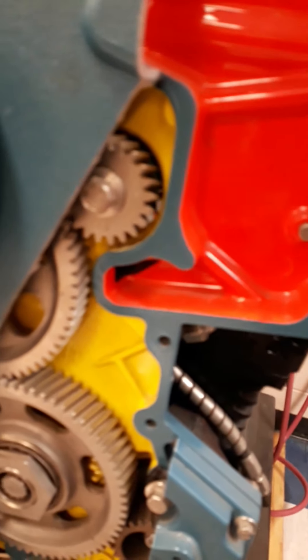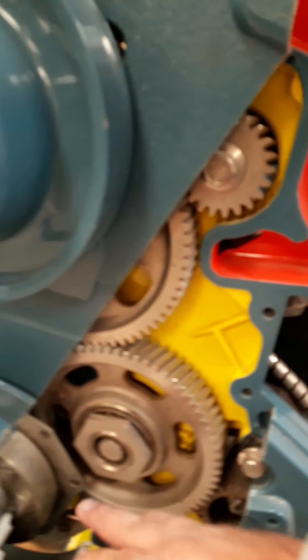Where this engine becomes a lot different is it uses engine oil to do the fuel injection. We've got our normal oil pump at the bottom that lubricates the engine and supplies the high-pressure oil pump. The high-pressure oil pump has an electronic spool valve where the ECM can control how much pressure it puts out. It takes about 695 psi to start a HEUI system and fire the injectors, and it goes up to a max of 3,000 psi — the computer controls that to rate and shape the injection based on load, temperature, and emissions requirements.